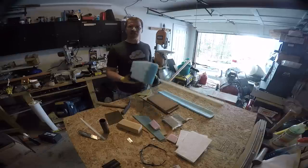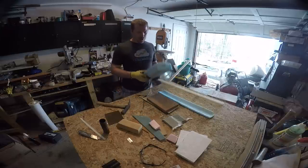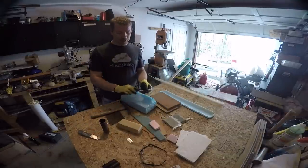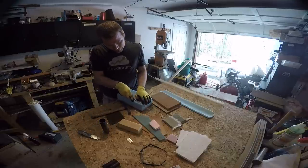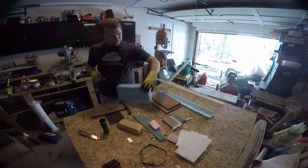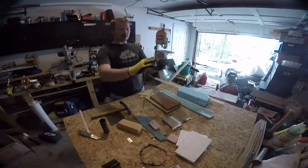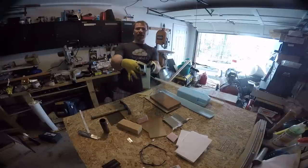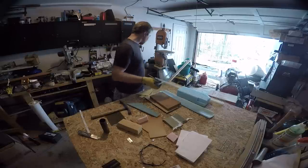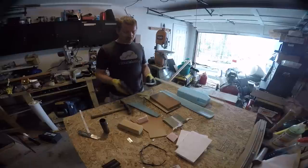These scraps have taken a beating — I use them as wedges on the wheels when working on brakes, to make sure if the car drops off the lift it's not going to damage your brake drum or disc. Styrofoam has some cool properties. Almost all of these foams are very easy to cut — just a standard hacksaw blade without even a frame. If I want to make a little mounting tab or bracket I can have a piece of foam cut in about ten seconds. This goes quick; it's really nice and easy to work with.